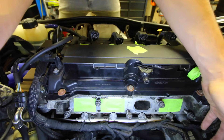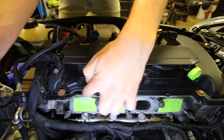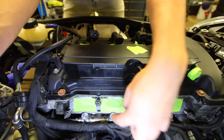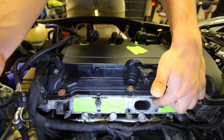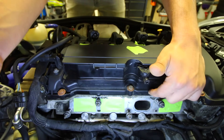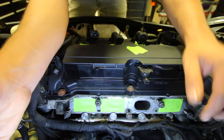With the intake manifold removed from the block and the head, I've taped up each one of the ports — cylinders 4, 2, and 1 — with 3M automotive tape so that when we walnut blast cylinder number 3, we're not going to get any walnuts inside the other ports. The way we do this is we need the pistons to close up these valves. If the valves on the cylinder you're working on aren't closed and you start walnut blasting, you're going to get walnuts inside the engine and kill your motor.